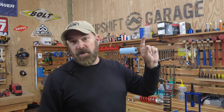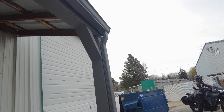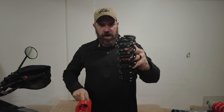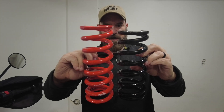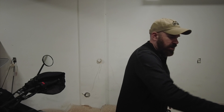Thanks to the folks at Upshift for letting us use their garage. If you have any motorcycle-related parts or stuff you need to work on your bikes, they have a whole collection of stuff — check them out at TimberMoto.com. Now we've got our shock, let's head back home and install it. We're back. You can see the difference between the two: here's the stock spring and here's the spring we replaced it with — substantially longer and beefier. That should definitely help out with the bottom-out issues and allow us to adjust sag properly with all the weight once we put all the luggage on.